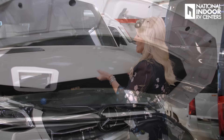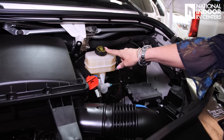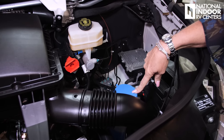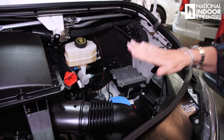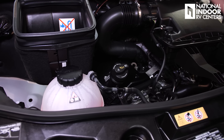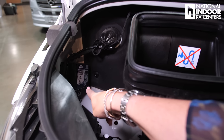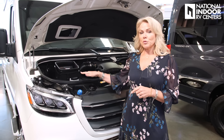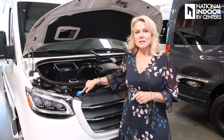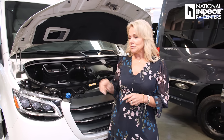Now that you've seen the quality on the underside, let's take a look at what you get with the Mercedes. We've got the negative jump start terminal and your positive. Right above that, we have brake fluid and windshield wiper fluid. This is electric power steering, so you won't see a power steering fluid reservoir. On the other side, we've got the oil fuel fill — no dipstick, because you'll see that reading at the dash. We've also got coolant, air intake for the engine, and the wake speed regulator that works with the lithium ion system. Then there's the DEF fluid — that's your diesel exhaust fluid. It has a shelf life of typically one year, doesn't like sunlight or heat, so if you put in bad DEF you're going to throw some bad engine codes.